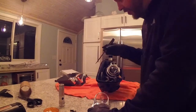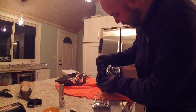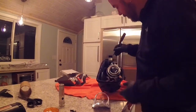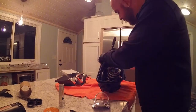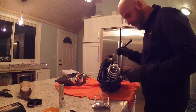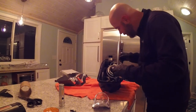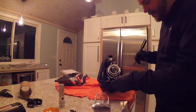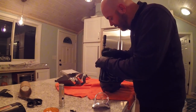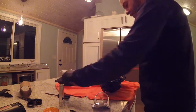When you're doing your butyl run, take a screwdriver and kind of knead it back in. Heat it all the way around the edges - you want to push it all back towards the middle. When you install the lens back in, run your heat gun around here and install the lens. You want a fresh area of butyl. I'm going to fill up this gap a little more along the top edge here. I'll go around and knead all this back in to get it centered and uniform.